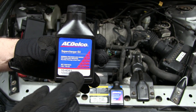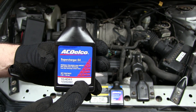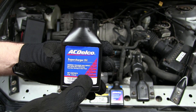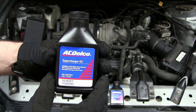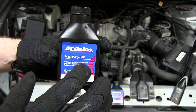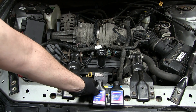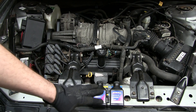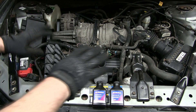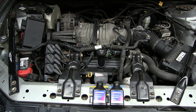GM put out a bulletin that said if they were doing a service like this and didn't have this fluid on their shelf, they could use synthetic 5W-20. I'd like to think there's a little something more to this fluid in the bottle than off-the-shelf synthetic, so this is what my car calls for and this is what I'm gonna put in. You only have to do this service once every 50 to 60 thousand miles, so I've got a long ways to go before I'd have to do this again. The whole project only cost me $42 total — you'd expect to pay about $150 for this at a dealership. Hope you enjoyed the tips and thanks for watching.